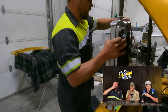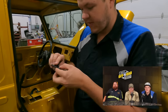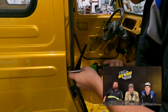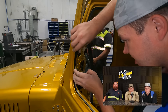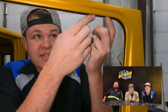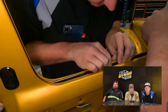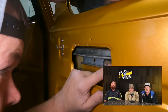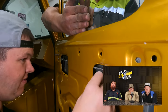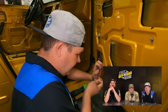We're going to get our striker plate on. Door number two is done. Door number three done. Get all this felting set — we've got the run channel all the way down inside, got all this nice felting all the way around. We used a plastic bag for an extra layer of protection. That's fitting like a glove. Now we've got to disassemble the inside of the door, take the regulator off, take the run channel track off, wiggle the window in, maneuver the rollers on. All done. We're going to be passing it off to FabRats so they can get all the brake lines, fuel lines, wiring, and everything done so the Golden Nugget runs.